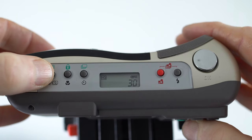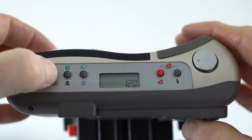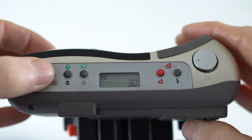Like most consumer cameras in 1996, the three CAMEDIAs stored their images in internal memory, leaving removable memory cards to more expensive or later models. The C400, C400L and C800L were equipped with 1, 2 and an impressive 6 megabytes of memory respectively, and the latter on the flagship C800L really let it stand apart from the crowd, allowing you to store up to 30 photos in the best quality mode or 120 in the standard. But obviously when the memory was full, you either had to delete or download the images to free up the space.